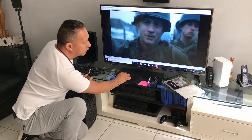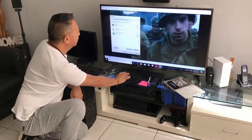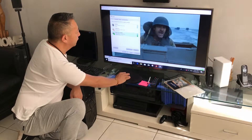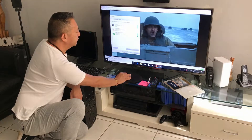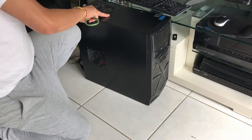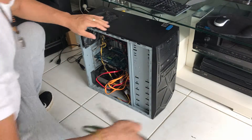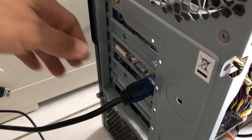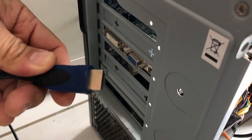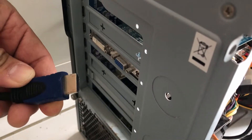If you have a look at the sound menu, just right-click on that — Sound. Go to playback devices and you can actually see audio going through it, but no sound. It's the standard HDMI cable. The HDMI should be able to supply both video and audio output into the TV, so we really should be able to use the TV speakers.